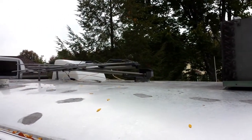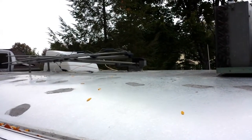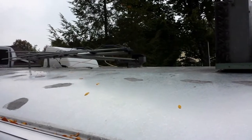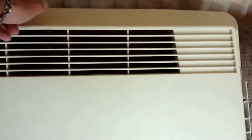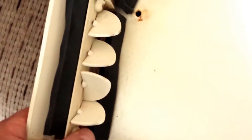One of the things we had to attend to is the antenna — it was broken. It's designed to have a Bakelite screw and socket so that if you hit a tree or something, it'll break to protect it. You can still get the parts in some places, although they're rare, and it really is a very effective antenna when it's working properly. Today it was raining, so I decided to take down the bottom of the air conditioner cover and clean underneath it, then do a repair I've been putting off. I took a piece of channel and used JB Weld to glue in the one broken vent, then added weather stripping along both edges so that when the vents open and close it doesn't leave a gap that lets air through.